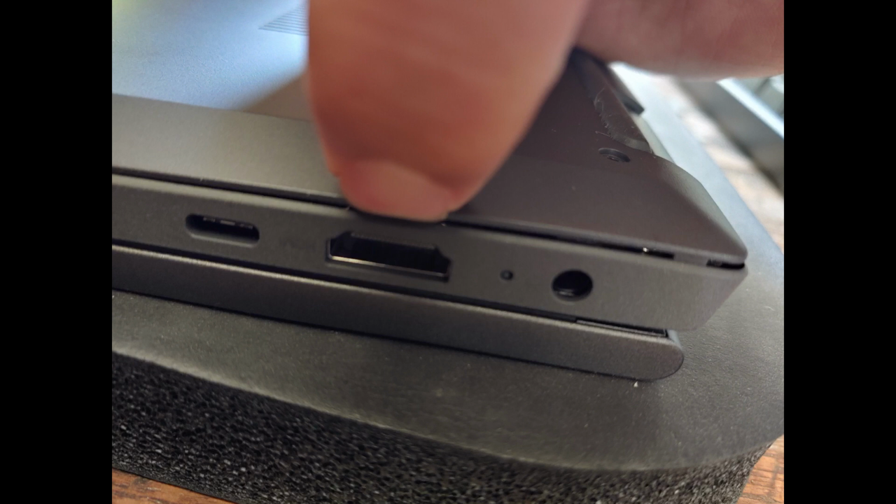After you remove and store the screws aside, you will need to pry it up because the plastic panel has small tabs to hold it in place even without the screws. Use something soft like a plastic spatula that came with a cell phone repair kit like I talked about earlier, or an expired credit card. Don't use stuff like a flathead screwdriver, as this will damage the plastic panel.